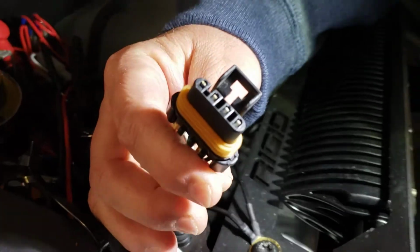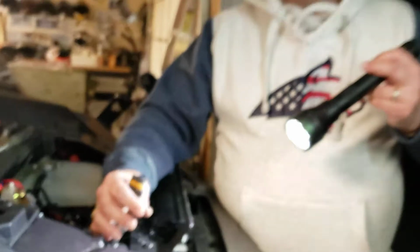And the hardest part of this again was actually removing the little rubber waterproof grommet of some sort inside that little holder connector here, and to get it out was actually tough. So we used the drill bit, pushed it up through. Eventually we were able to get it far enough up, pushing it backwards towards where the wires come in. Then we used the needle nose pliers to grab hold of it and pulled it out. First one went great. Second one we tore, so it took a little extra effort. But once you get that out, everything else is super, super simple.